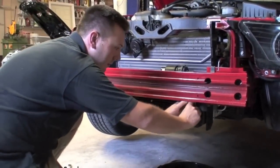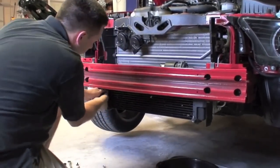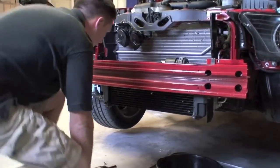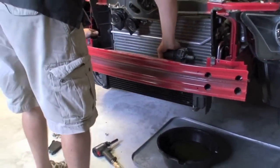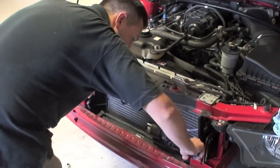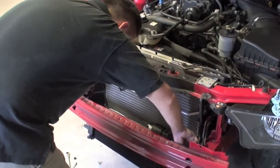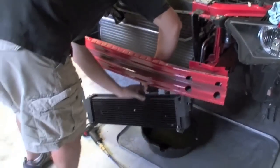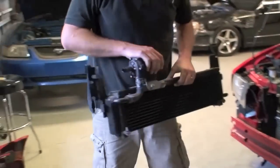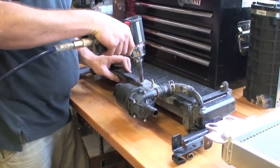These little wings on the front of the heat exchanger need to be removed before it can be pulled out. Now the heat exchanger should be lifted up and then slipped back down. Now we're going to remove the stock intercooler pump from the factory heat exchanger.